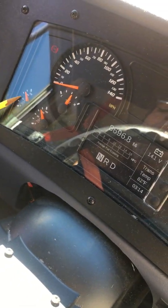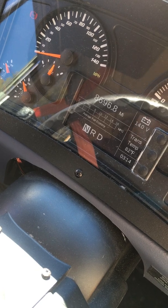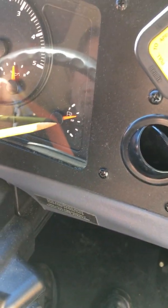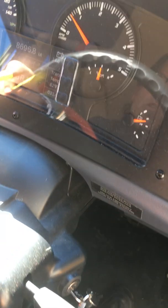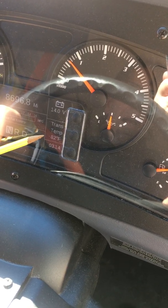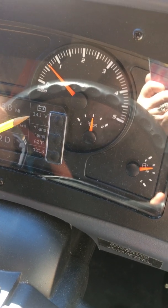Those are my air pressure gauges. There's one for the front air tank and one for the rear air tank. They should read approximately 120 psi. Then there is my fuel gauge over here. It should be at an adequate level because E means empty, it doesn't mean excellent. Over here, my transmission temperature. We see that it's building, but it should read between 130 and 190 Fahrenheit when the engine gets a bit warmer. Over here, that's my voltmeter. It should be between 12 and 14 volts.